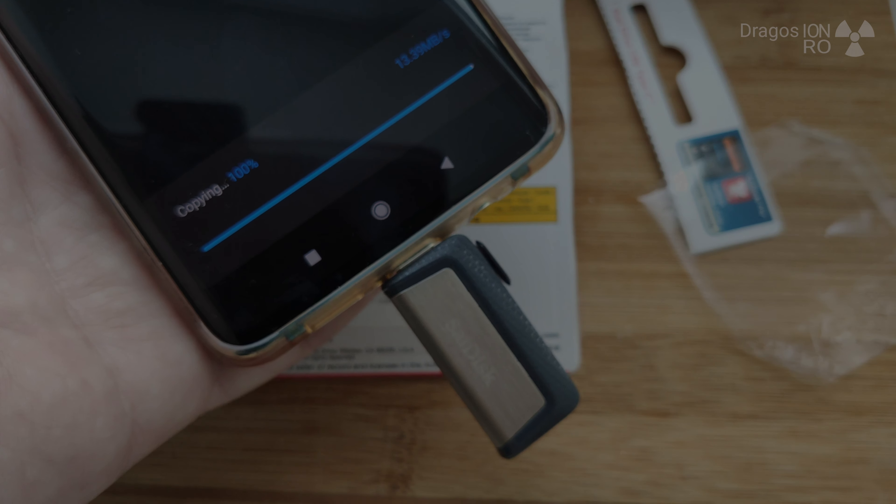Here I'm doing a write test to test the whole drive. First I did a small sample just to show you, and later — I didn't record it — but eventually I show you that I tested the whole drive. This is a 10 GB test creating a bunch of files on the USB and then verifying them to make sure the files are correct.